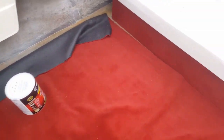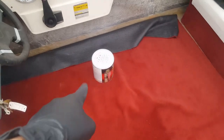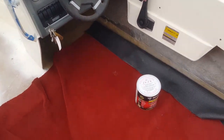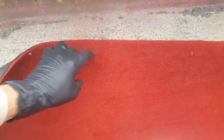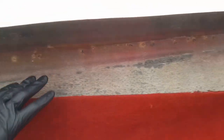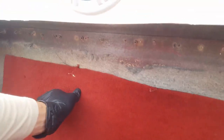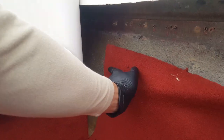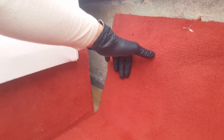I'm going to get more carpet to do the forward piece — the bow area — and we'll talk about that when it comes in. For now we'll bond the carpet down to the back section, then move on to getting these captain chairs installed. This is 8.5-foot carpet — the color is called Claret. I'll get a sliver to cover the rivets where the upper and lower sections of the boat were connected. I may also leave that little piece of Kevlar down there as a conversation piece.